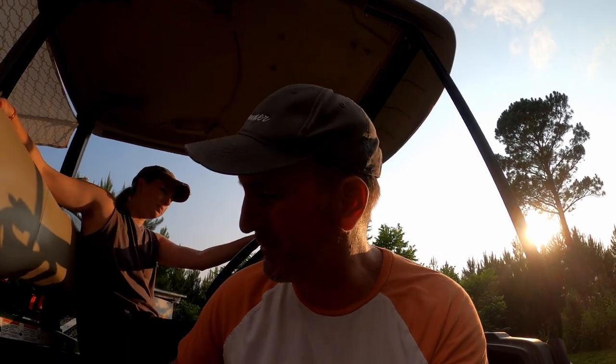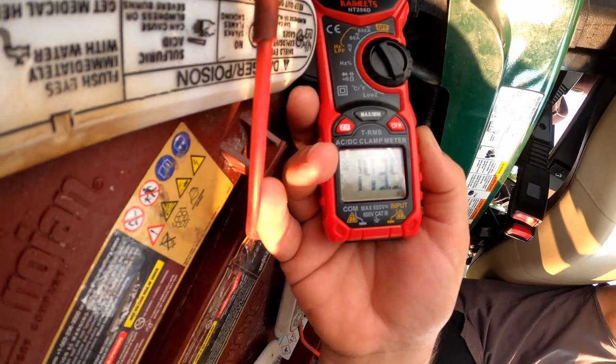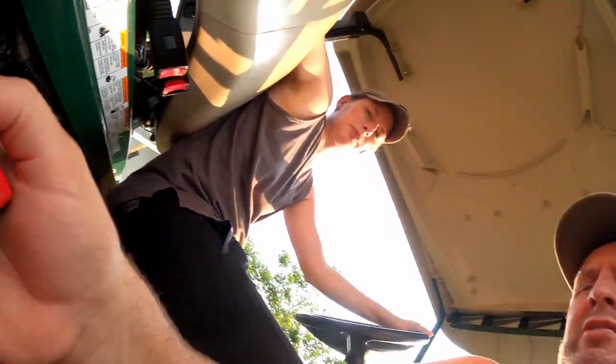After some light driving and a little bit of heavy acceleration, we're pulling 143.9 — 144 amps. So that's probably about as much as we'd pull from a battery in a normal situation. I think the 200 amp max battery would work for us.